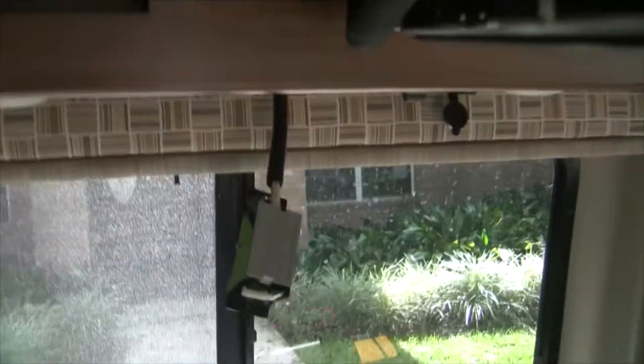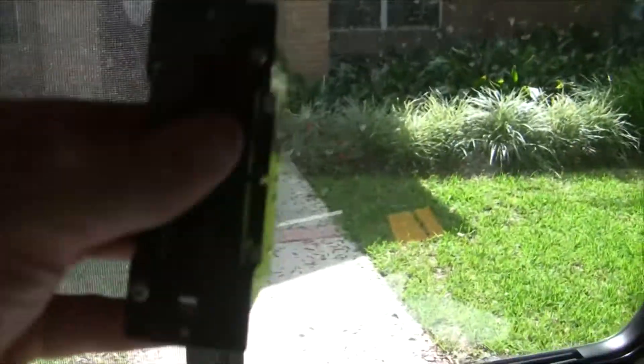Next I need to power an AC outlet from the inverter. This outlet was already here — it was wired into the generator and shore power — but I disconnected that wire and ran my own Romex wire instead. It runs up behind the TV, across the cabinet, down behind the fridge, and comes out behind the inverter. I put a plug on the end, so now that outlet will be an inverter-only outlet running off the battery — unless the inverter is on, that plug won't work.